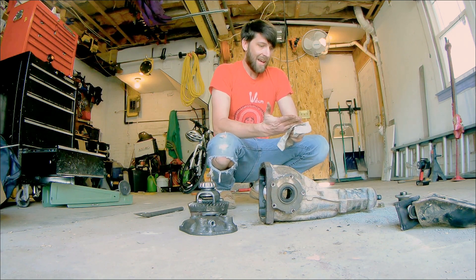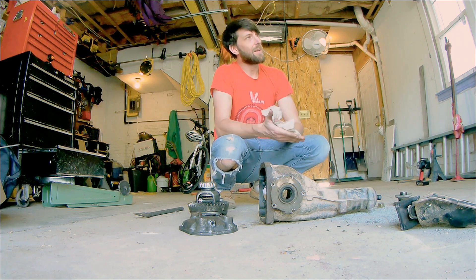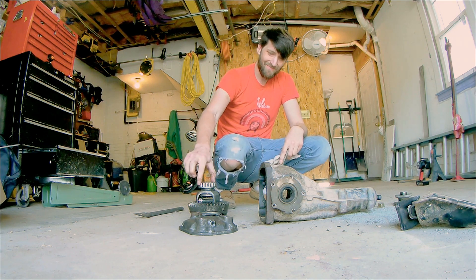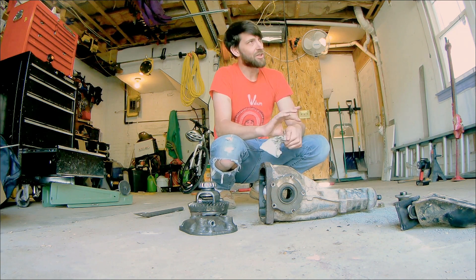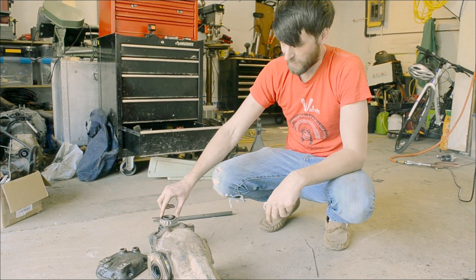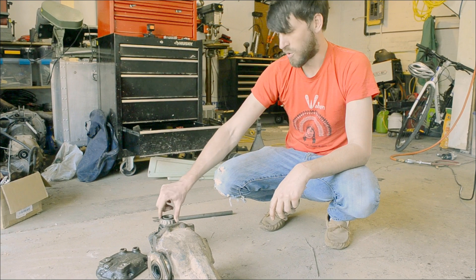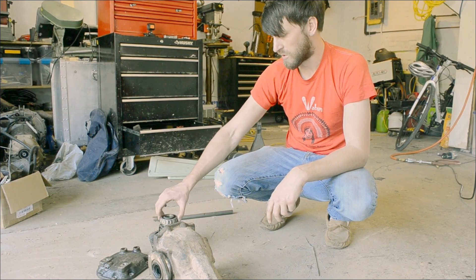But in theory you could. If you're going to go to that trouble, you may as well put a good limited slip in there, because these viscous limited slips aren't that great. The nice thing about them is you can't really destroy them like you can a clutch pack — you can burn out a clutch pack — but they don't provide as much torque as the clutch pack. If you're going to go to the trouble of pulling the carrier, I would get a Torsen limited slip for off-roading, as that's what Humvees actually have.